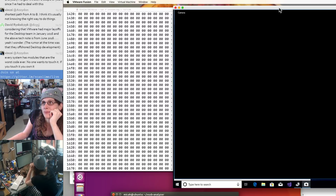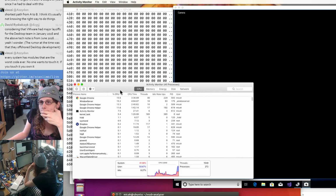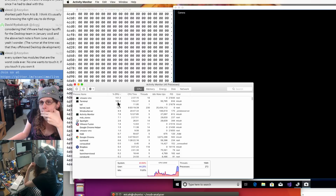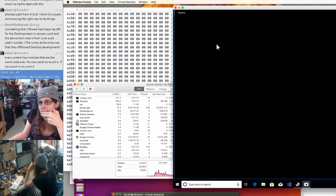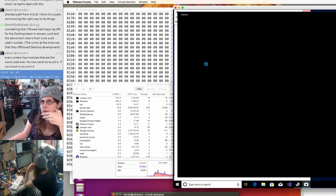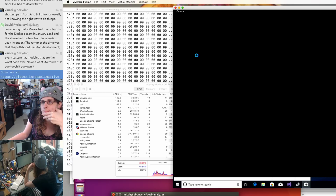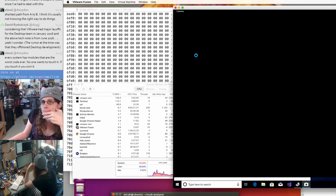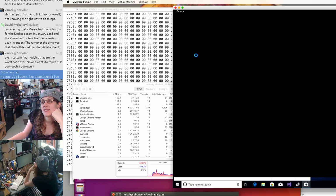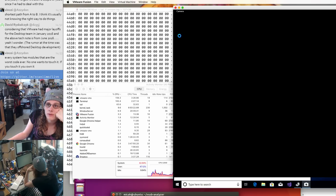This might not be able to keep up with the terminal spewing like this. If it can't keep up, it's quite possible that we just won't see any frames. This is actually when it is kind of useful to take that max line option and turn it way down, like to 1 or 2. Because then you can still see the headers for the transactions, and you can see the timestamps, but you don't actually clog up the whole system with logging.